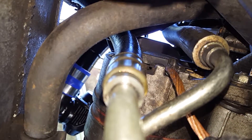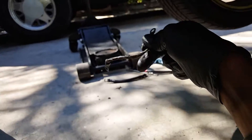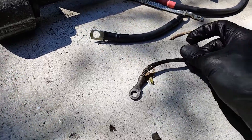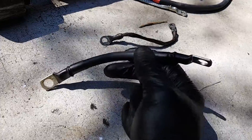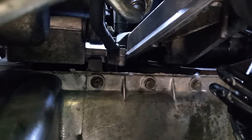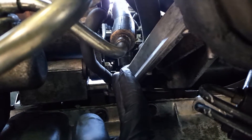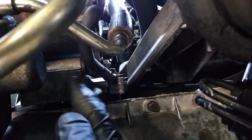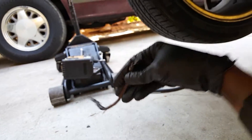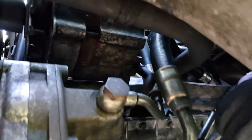Got the first 13 millimeter bolt off, and the next bolt right up there is a 10 millimeter. Go ahead and take a wrench and pull that. You can see the little tiny measly cable only giving me so much ground — and then the upgraded Bavarian Restorations cable is a lot thicker. The ends are soldered so they're a little stiff, and the connectors are a bit bigger, but with a little elbow grease it goes right into place.